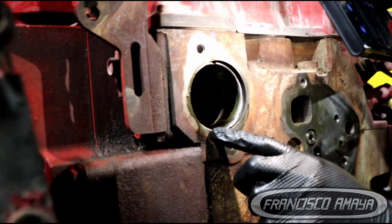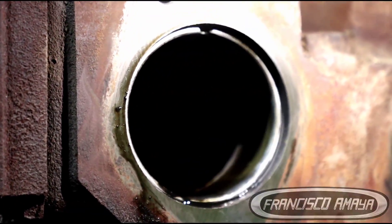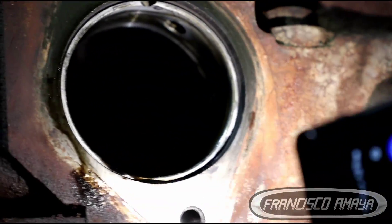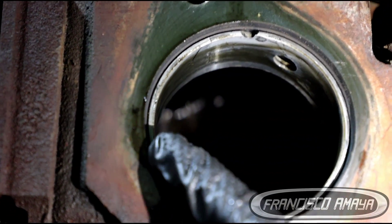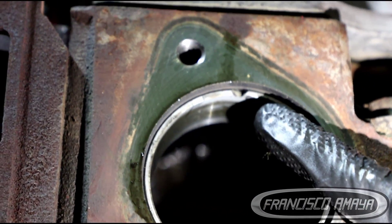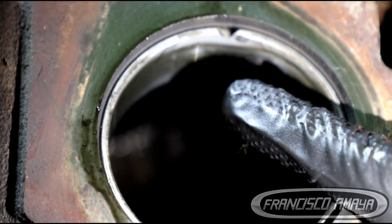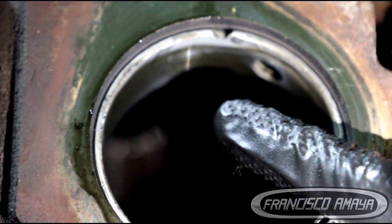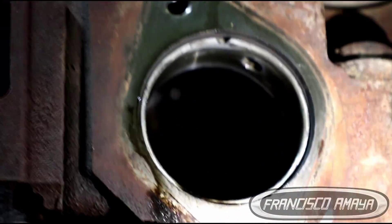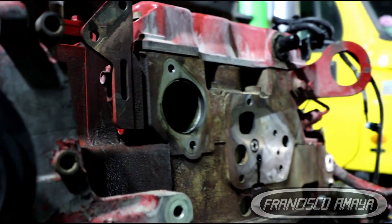See how damaged it is? You can see all this damage on the bottom — that is fully damaged. On top, you can see the metal. The marks on it, all these white marks — that's the way a bearing looks, but inside it looks all silver. That is the pure metal of the bearing exposed. So that bearing is damaged and has to be replaced. That is a very common problem on Cummins ISX engines.